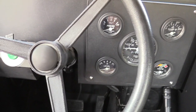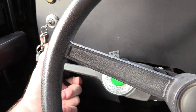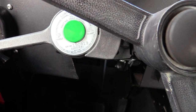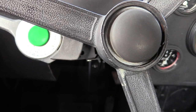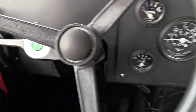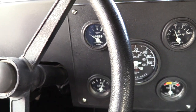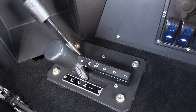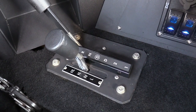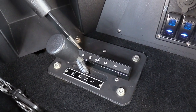Here at the steering wheel area, I'll show you what comes on — I'll turn the air off so you can hear me better. These are the headlights, and then we've got our turn signals. The radio comes on — you can see that. Turn signals left and right. This still has the factory military switch, so you have to learn how to use it. Here's all the instrumentation. Truck cranks right up and drives great. It's full-time four-wheel drive, running H right now. It also has HL for high lock, which locks the differentials, and L for low range. All that works properly. Has an e-brake here.